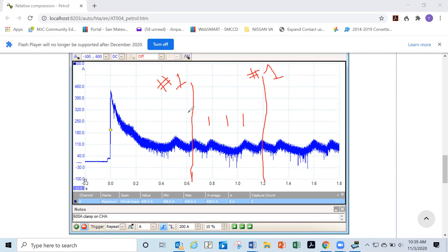And so then I could figure out, because I know that on a 4-cylinder, which this is apparently, the firing order is 1, 3, 4, 2, 1, 3, 4, et cetera. So I know that 1, 3, so I know it's number four. Oh, it's the number 4 cylinder that's acting up, okay? So that's the cylinder that's giving me the problems, okay? So that's how we would sync that up for that pattern. Okay, and remember, what are we gonna hook up?